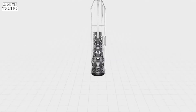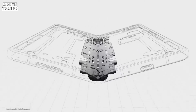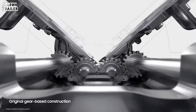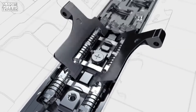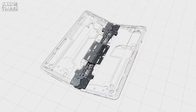The hinge is at the very heart of the foldable experience, powering the unparalleled flexibility that makes these devices so unique. The first three generations of the fold used gear components, which enabled the screen to be folded and unfolded equally and seamlessly. However, that gear design made it difficult for us to reduce the weight and size of the fold's hinge.